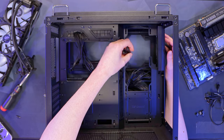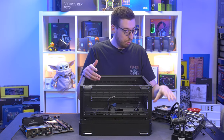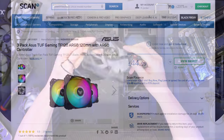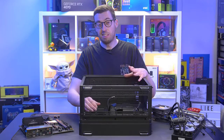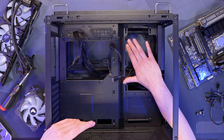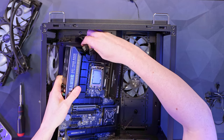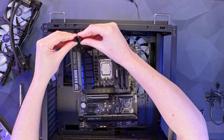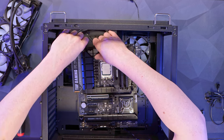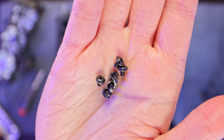Now we can install the motherboard and the AIO. I'm also going to quickly install some additional Asus AF TUF fans — a three-pack for around £40. I'd ideally like four fans but with three I'll put two in the top right for fresh air drawn in from the filtered back, and one as rear exhaust. Before fully bringing things in I'm going to install the EPS connectors first, as it was very tight with the fan there, so getting those in now makes life a lot easier.